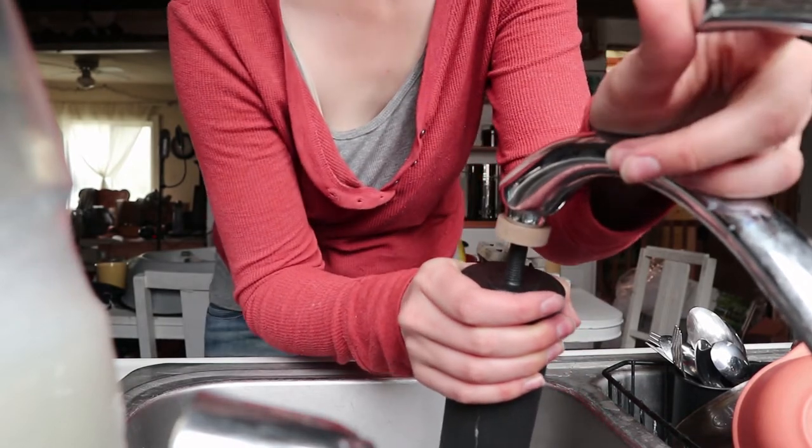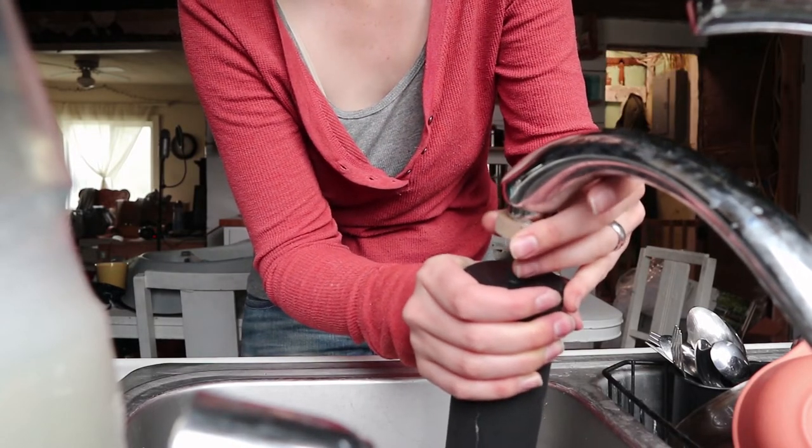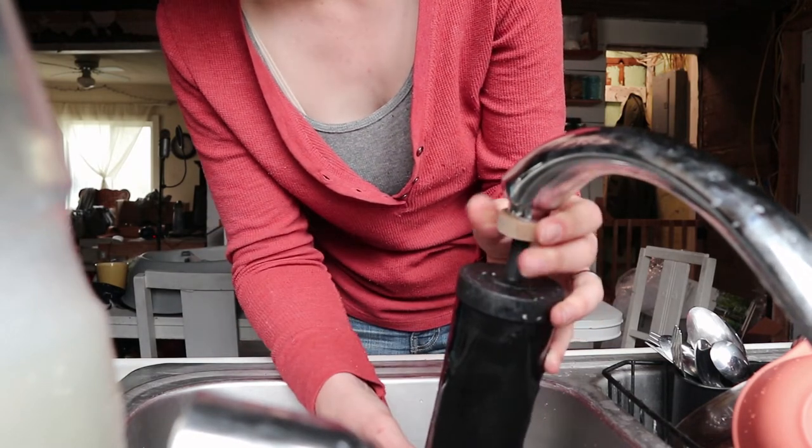Here are the filters and they're really lightweight right now. There's a lot of air in them, and that's the reason you prime these. There are two ways to prime the filters. Using the tan ring is the main way — you put the tan ring over the filter stem and hold it up under the faucet so that the water is forced into it. Then there's also a blue attachment that you put over your faucet and force the water through that way. I'll do one filter each way so you can see how both work. You want to use cold water for priming — gradually increase the water flow. We're just trying to force water into the filter until you see little beads of water seeping out all over the outside of it. It takes about a whole minute to prime it completely.